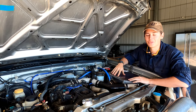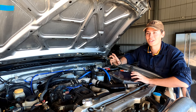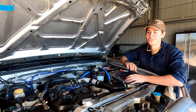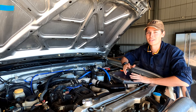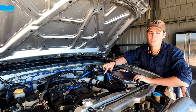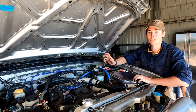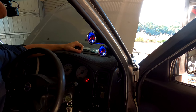For the ZD30 guys looking for a turbo upgrade, there's not much out there in terms of aftermarket upgrades - they offer billet wheels but I'm not sure they actually affect performance. If you want to upgrade you can go to the ZD30 variable geometry turbo from the Patrols - it bolts on, you just have to do the intake, dump pipe, and oil lines which you can buy. I've got a video on it so go check my page.